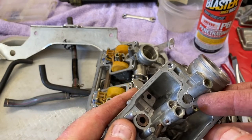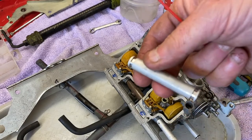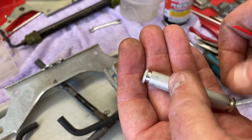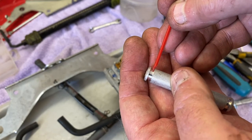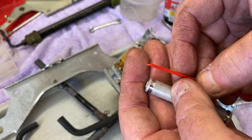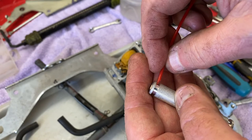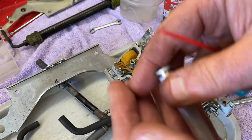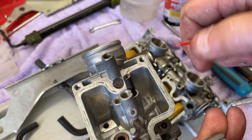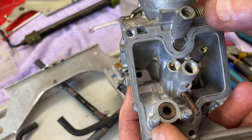I'll do any final cleaning — just pick residue off with a plastic instrument. You want to stay away from metal on these when prying O-rings out. When taking O-rings off fuel tubes or fuel tees anywhere you have to peel an O-ring off something, definitely don't use a steel tool if you can help it, because if you gouge that surface, you risk a leak. I just make a plastic pick from a straw from carb cleaner — cut a nice angle on it — and you can generally reach up underneath there, use a little silicone spray if necessary, get underneath it and pull it off. That way you don't scratch the sealing surface.